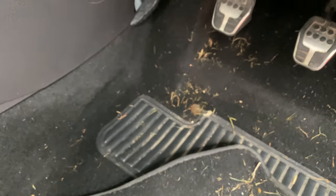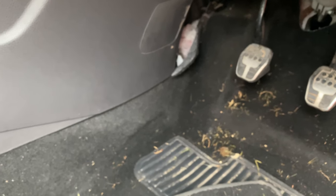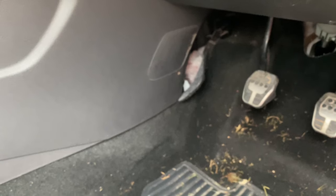I'm going to have to take it apart to fix it, which means the dashboard is going to come out. That's one place I didn't want the coolant to be. If you've got a Ford or any car and your coolant is going down, it's probably the heater matrix, which is not a good thing to have to fix. Can you imagine how much the dealer would charge? I reckon this is a two-day job — probably two thousand quid — but we'll do it ourselves, and it's quite easy to do.